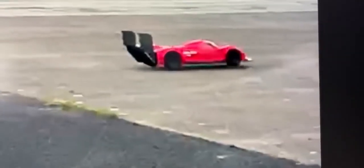The minute the rear gets lower than the front, the air can get under it and it can flip up, and then you saw what happened. So we come up to a bump here, and you can see the whole suspension of the car compresses. Then off here is a little step, and now the whole car is in the air. Forward a few more frames, it's airborne, the rear end comes down, and now the front is higher, and that is the moment of no return. The air gets underneath and it's game over.